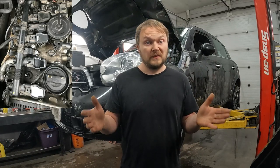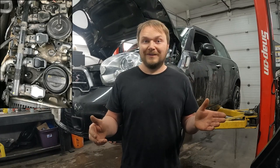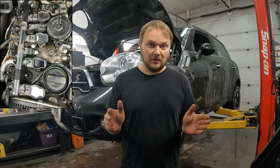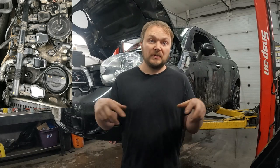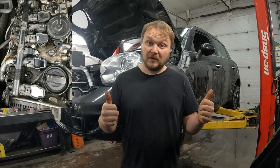One of the big takeaways from Part 1: if you're not super familiar with these Volkswagen engines, if you come across a 2.0L Volkswagen engine and you see a valve cover that is metal and it's got lots of fasteners along it, that's not a normal valve cover. Do not take it off. That is the camshaft retainer — it's got the caps built into it.